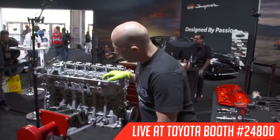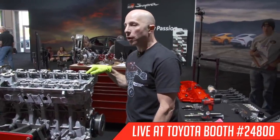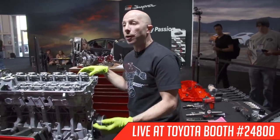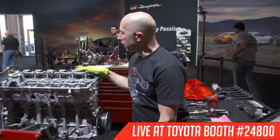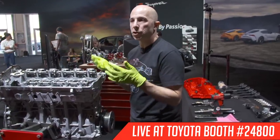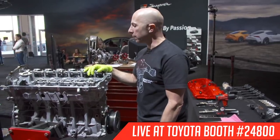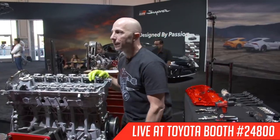Not really. The one scary thing is the intake rocker arm setup. If we're trying to go to 8 or 9,000 RPM and having these two rockers, we don't know. So one of the really big questions is how much RPM can we get out of this valve train? And if we reach a limiter, maybe we need more spring pressure, so how much work do we have to do to make a custom spring with more tension that could keep it all together? That's the one really unknown thing that we'll find out. Thanks. Any other questions?